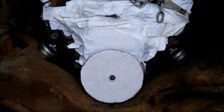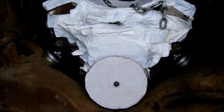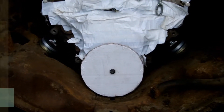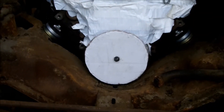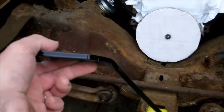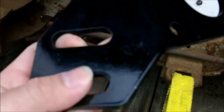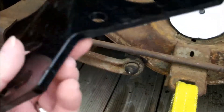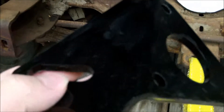Down at my toolbox, this is an LT1 — this one's a 95 — with a 700R4 shell strapped to the back just to help line everything up. I made a cardboard harmonic balancer mock-up to make sure I had clearance. The motor mount style is a little different from the angled style you see here, which bolts the engine and uses biscuit mounts underneath with one-inch, two-inch, or three-inch options. I ended up going with more of a V-mount style instead of the flat horizontal style.